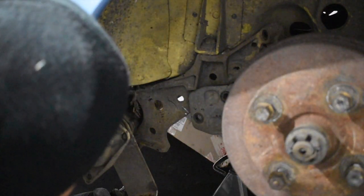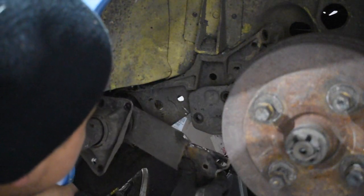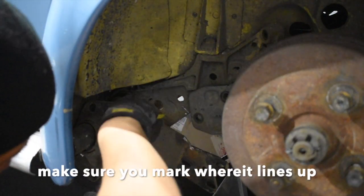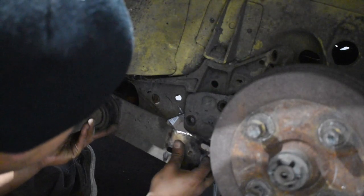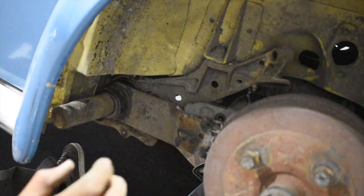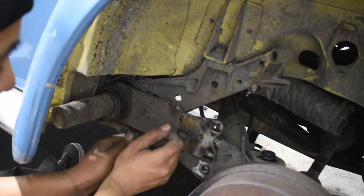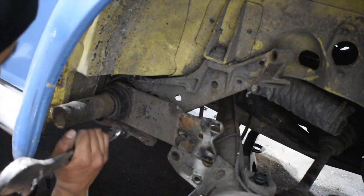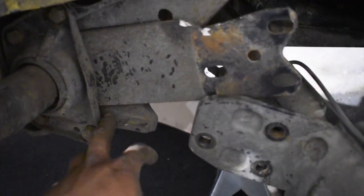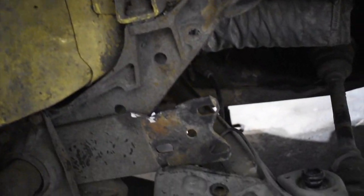Mine kind of just popped out. The bushing is directional, so it only goes in one way — so in case it falls out like that, you know how to put it back in. I turned it up three notches — so I basically took it out, twisted it, felt the little grooves on the inside of the actual torsion bar, moved it up about four times. That should give me all the clearance I need to run what I want. So I put everything back together, everything's moved up. I marked the markings right here and that's just with four teeth being moved up. So right now I'm going to put the arm back on and we should be able to put the bag on with no issues.